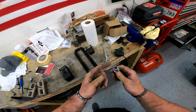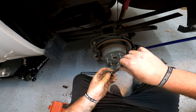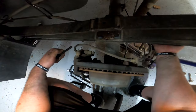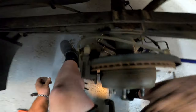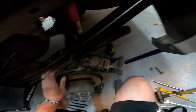Get this new stud bolt — it's a 14 millimeter — and that's why I put a washer and a lock washer on it; I want to make sure it's nice and solid. Grab all the hardware and install the stud first. It takes a little bit of muscle. Get your spacers — the longer one goes on the bottom. Then lift up and get the stud in. Once everything is lined up, start jacking back up. Throw your washer on. This kit does not come with a washer or lock washer — I highly recommend adding one.